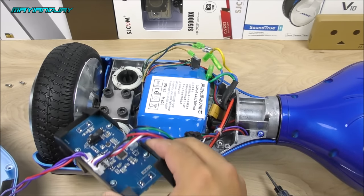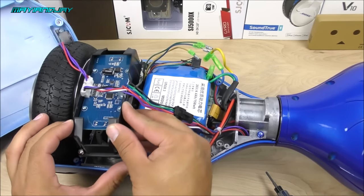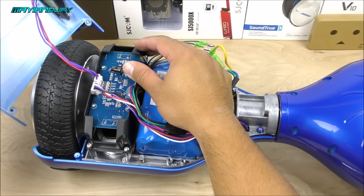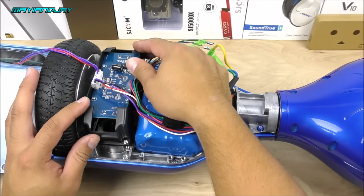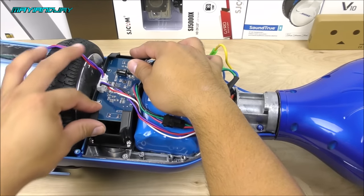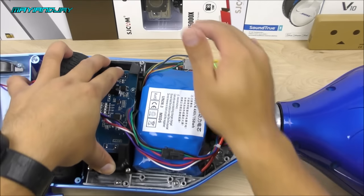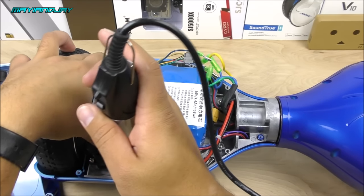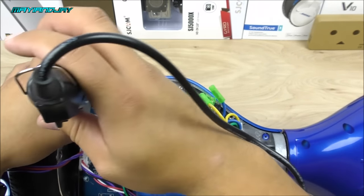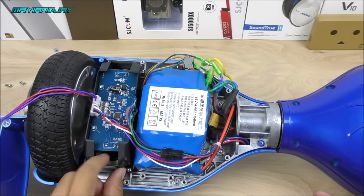After the motor is secured, install the gyro back in place. All the screws for the gyro appear to be pre-installed, which makes it easy. I decided not to force the glued wire connector to avoid breaking the connection point. I believe I've got it in place on both sides — confirmed. Let me grab my electric screwdriver and tighten all four screws.